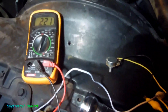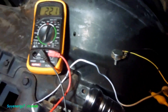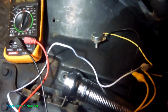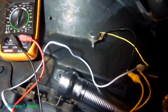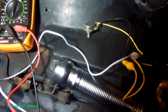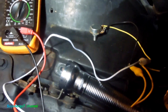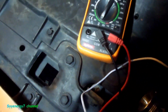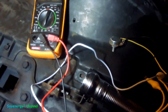I thoroughly warmed up the engine and the temperature gauge still stays below 100. I got a potentiometer here — you can adjust the resistance. The sending unit on a stock Chevy small block shows 600 ohms resistance for 100 degrees on the gauge, and 85 ohms resistance for 220 degrees. So I'm going to set it to 220 ohms and that should put the gauge over 100.